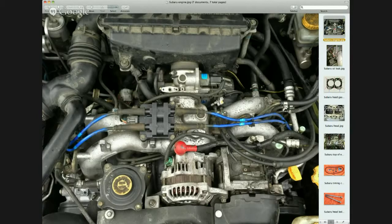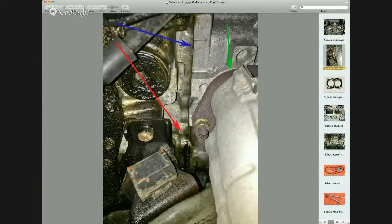So what happens typically with Subaru cylinder heads — this is the underside of the engine, a close-up view where the cylinder head gasket meets the engine. The bright blue arrow points right to where the cylinder head gasket is located, and to the right of that is the cylinder head itself. The red arrow points to an oil leak, and that is typically what happens with Subaru head gaskets — they leak oil. Sometimes they'll leak coolant as well. The cylinder head gasket is a very complex gasket: it seals the combustion pressures of the engine, it also seals oil and coolant. There's a lot going on at extremely high temperature, so the cylinder head gasket works really hard. Typically the leaks can start off very slowly and not much to worry about, but after a while they can become quite severe to the point of dripping a lot of oil on the ground.